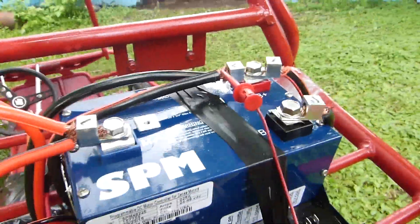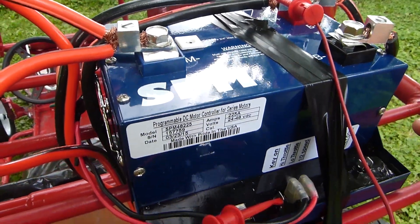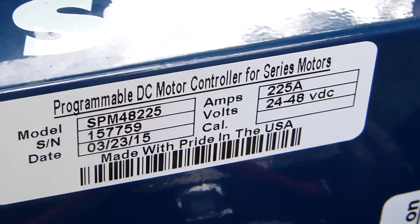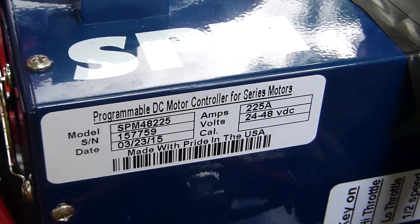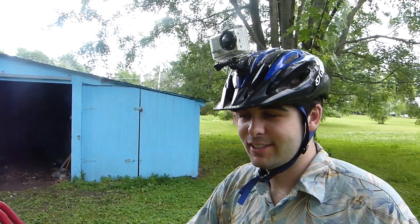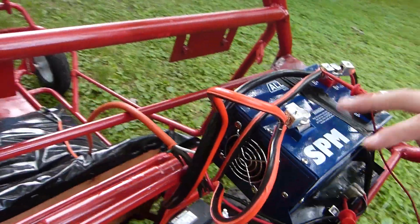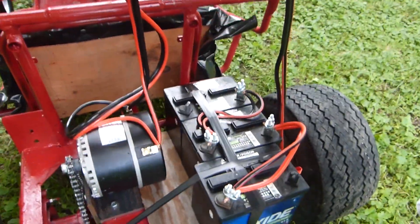What's better about this than your previous little board? So the little board was supposed to do 3,000 watts — that's peak wattage. So at 48 volts and around 20 amps, that's about 1,000 watts. We tried to push 60 amps through it and it just blew up. We tried another one that still didn't have enough power. This new one is able to do 200 amps — and you don't even hear it. It works great.